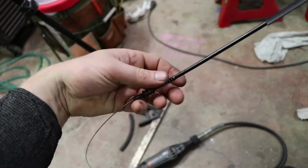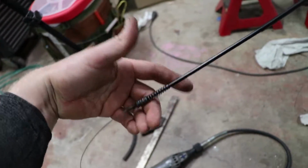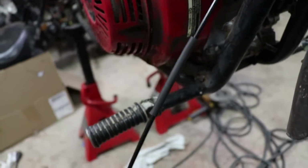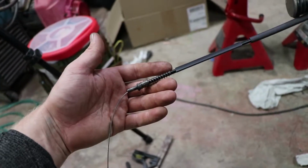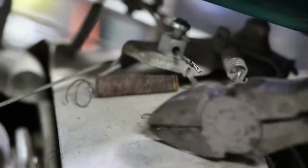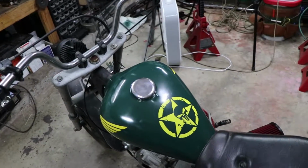To kind of show you what I'm talking about, this right here is the same type of setup. It's a little spring, you can get it at a hardware store. It's tapered, so it's small on this side, large on this side. Throttle end, and then heat shrink here. This big one will go over, small one will go to the end of the spring here, and that'll keep everything from getting kinked. And I kind of like the setup there. Okay, so that will keep it from fraying if you add a little solder to it with the soldering iron. All right,